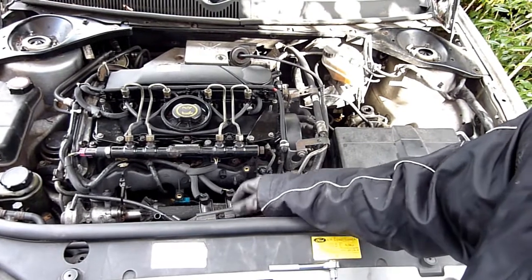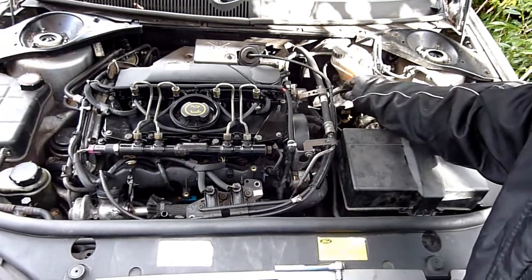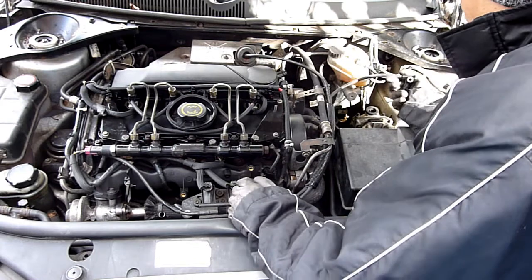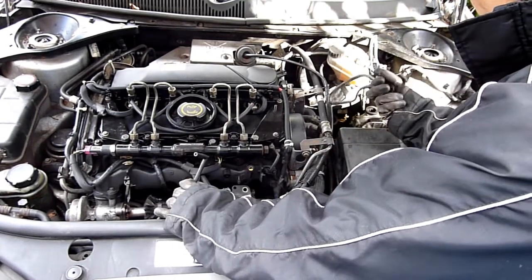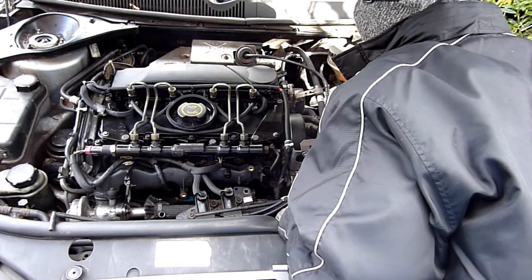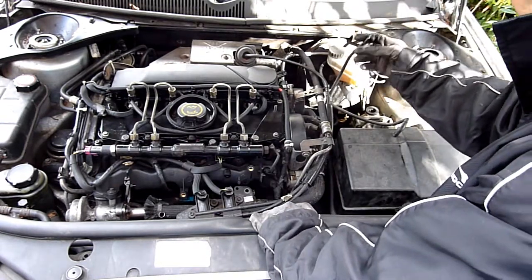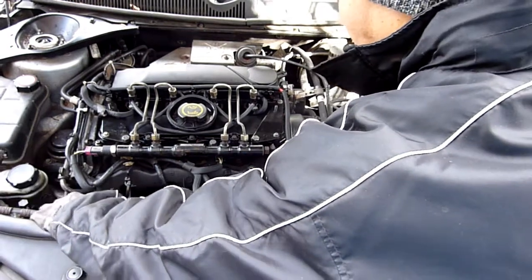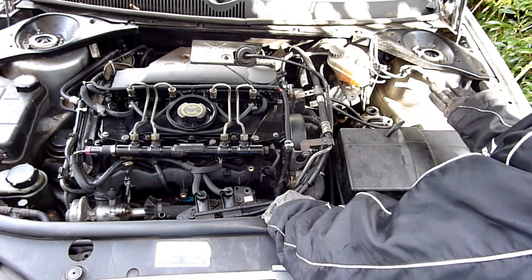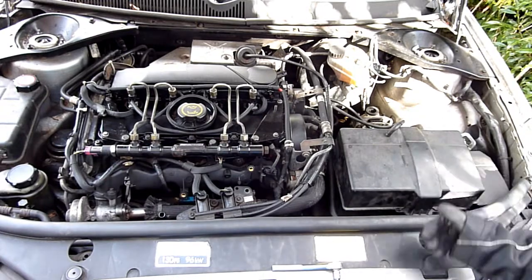So this has been removed. By the way, this vacuum hose links to the top cable — it links here, and it links to these two rubber hoses. This fits onto the little vacuum box on the bottom of the air filter; this one fits onto the top of the air filter. The bigger diameter hose and the bigger hole — it goes into this area here. I guess the air vacuum is created inside the top, which — a bit bizarre really — is used to operate the EGR. I'm not exactly sure, but that's the facts of it anyway.